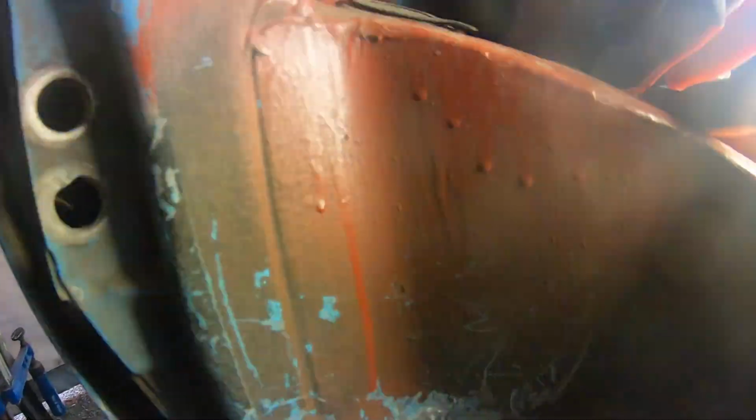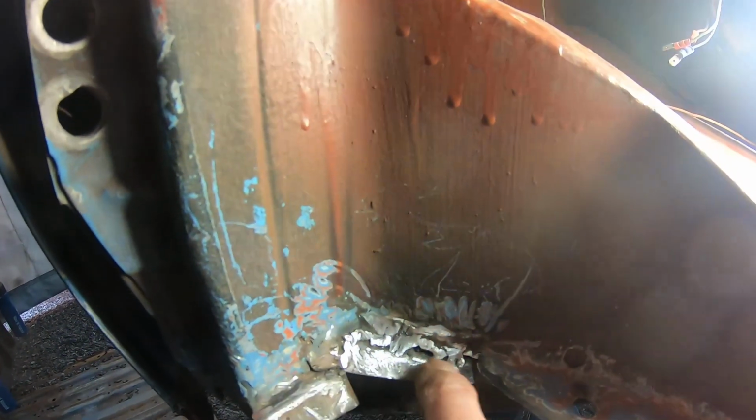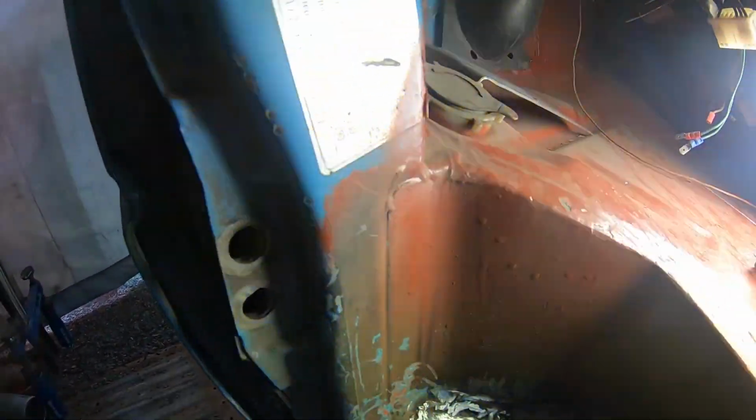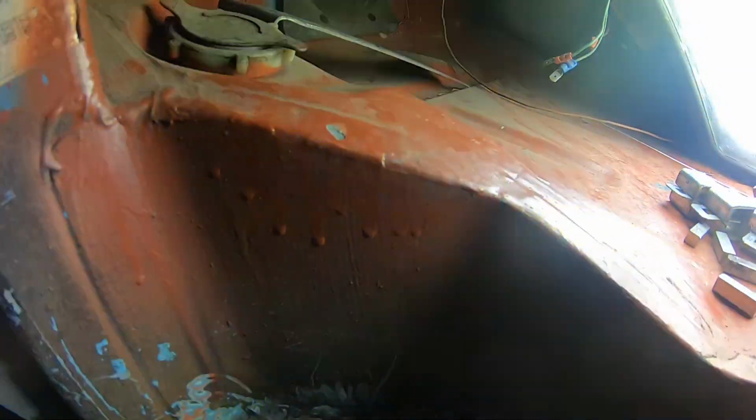So I premounted the dog leg. Here I made the new patches for closing the instep to the dog leg. I have to make some small adjustments here. So one new patch in here, I welded in here, so I can close it completely with the new part I've done here. So it fits.